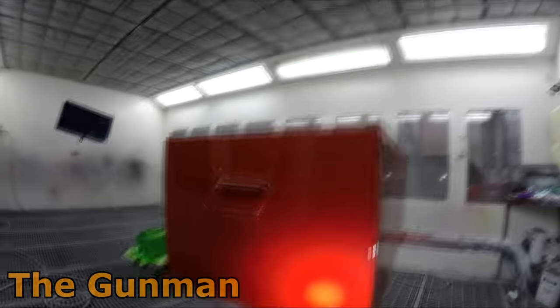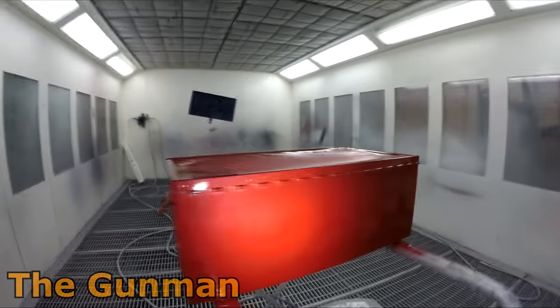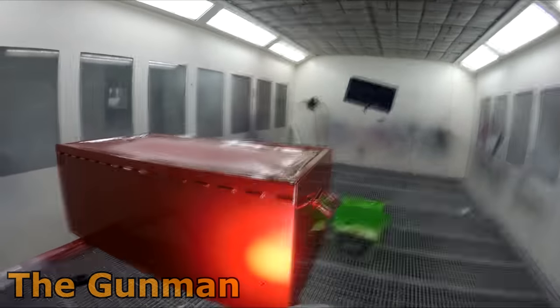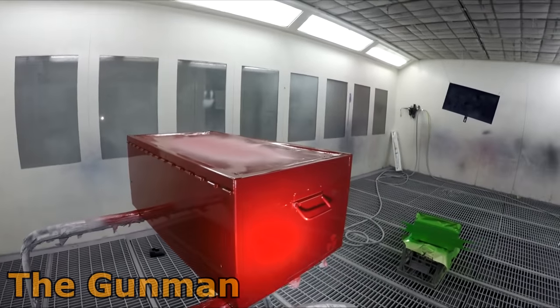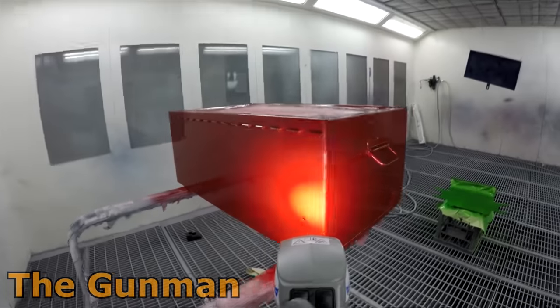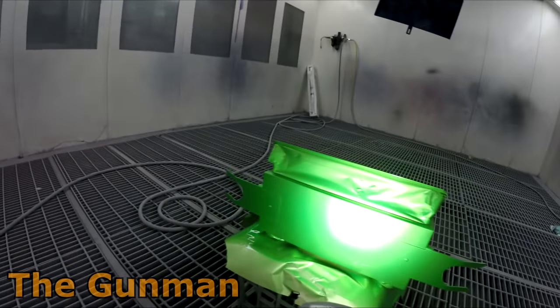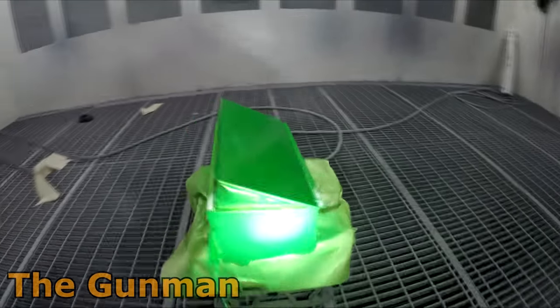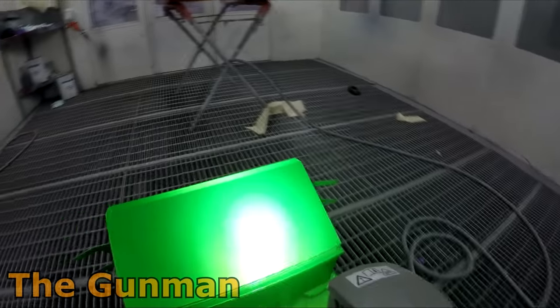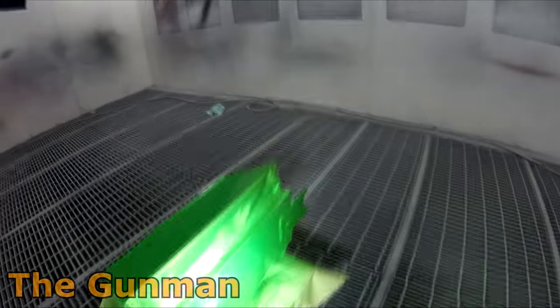But yeah, back to the actual color itself, I think that's pretty nice. The back, you can see I put one less coat on the back there of the candy, or the fake candy, and you can really see that it's made a big difference. And same with this part here, I put less of that fake candy over the bottom because I was starting to run out. And you can really see that that extra coat, so the three coats, is really where you want to be.